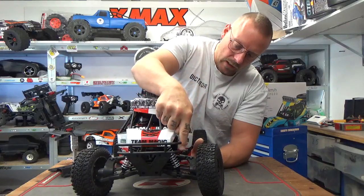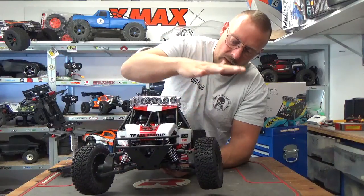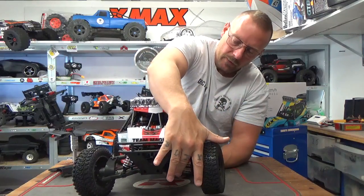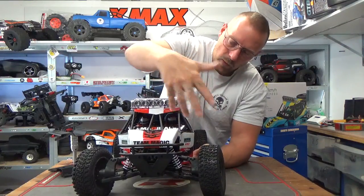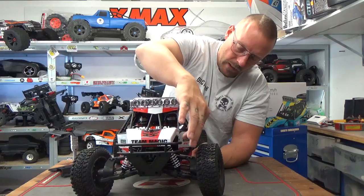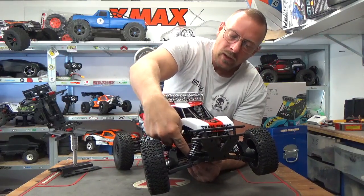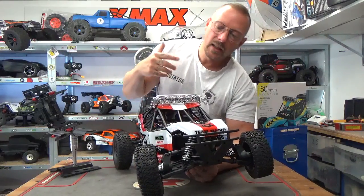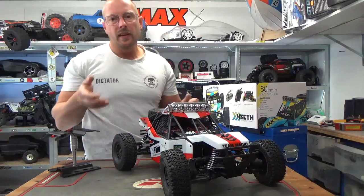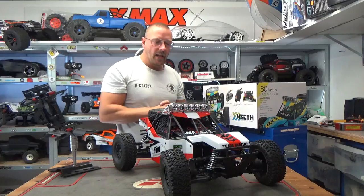That means if you really unleash the A-arms to have a big ground clearance in the front, you will have an issue. I will put the body away after that to show you better. The pin from the CVD hits the bottom of the output drive shaft, and this will clearly destroy your differential. That's something we see on many other cars.